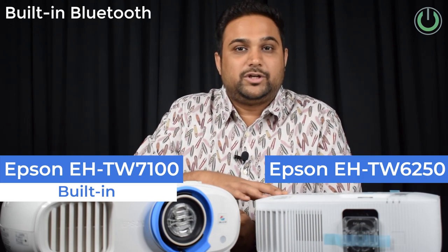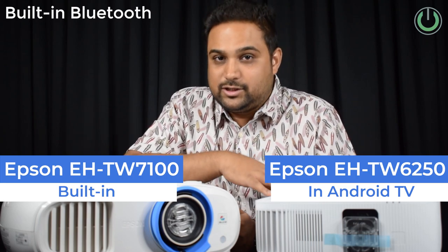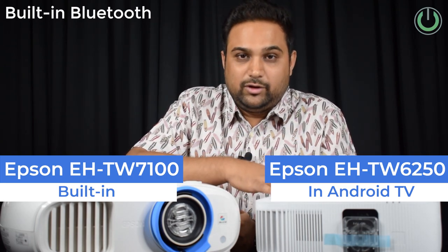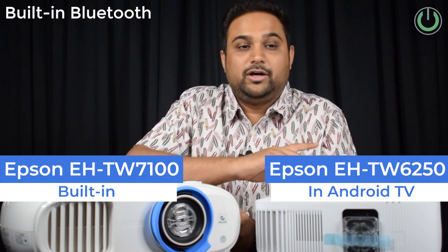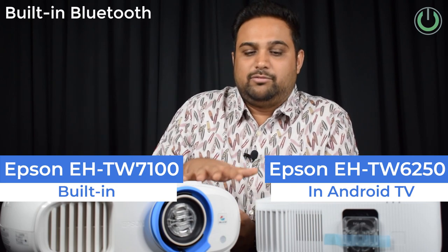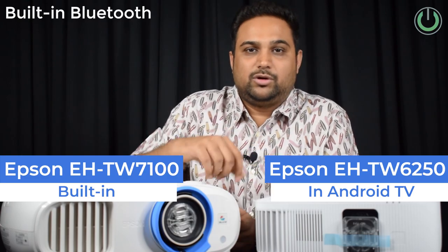Whereas with the 6250, the Bluetooth is not of the projector, but it is of the Android TV stick that comes inside the projector, and you will not be pairing the Bluetooth of your device with the projector, but eventually you would be pairing it with the Android TV stick's Bluetooth. So that's the disadvantage with the built-in Bluetooth versus an Android TV Bluetooth out here.